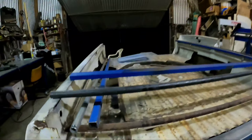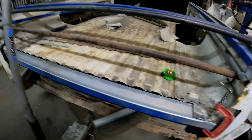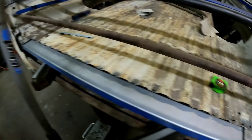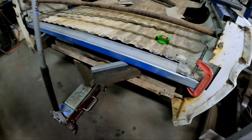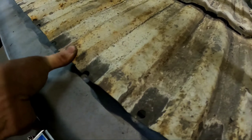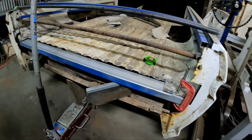So the job on now is to get this front beam welded in. I've just spent the last while measuring, trying to figure out where this thing's going to be center. The way it's looking is these lines in the floor are pretty accurate where the floor joint is, so I've sort of based it off that, and also going off the original mounts in the bottom panel there — or bottom beam, what's left of it. So I've tacked the floor to it, get that pulled down. As you can see it's got a bit of pressure to come up just because of the way it's been sitting. That's why I've been wanting to get this beam welded in — try and get some sort of structure back in this tub.